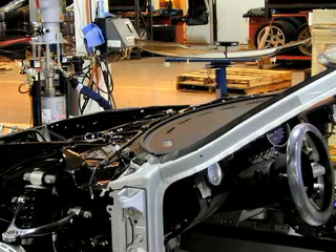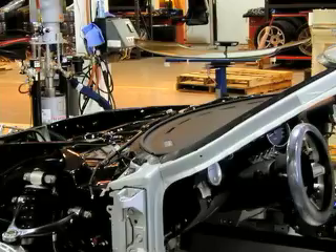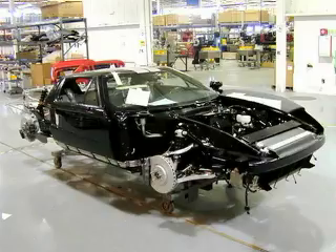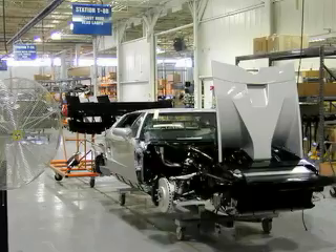Here is where the body line portion of the assembly process begins. The first step is installation of the windshield and mid-light glass, which is the glass between the cabin and engine compartment. Latches for the engine cover are also installed, as is the pressurized overflow coolant bottle. The doors and fenders are officially attached to the body. Several components go through a sub-assembly process before being attached, including the front and rear fascias, the engine cover, and the wheels and tires. The rocker panels and quarter panels go on next, followed by the side splitters, which act as air deflectors to provide the Ford GT with downforce at high speeds.